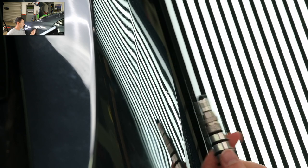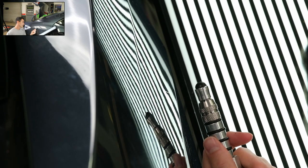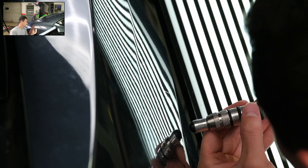You got a little pinch right there. With tap down, there's really no right or wrong — tell me why you're going to use it. I'm going to try this again and see what the metal does. It's such a tight pinch I might go to something else. See what happens with the metal. That's all it needed — way better. All he needs to do is take that pressure off so it'll allow him to push further into the dent. A pinch is like cancer to the dent because it won't allow that panel to come back clean.